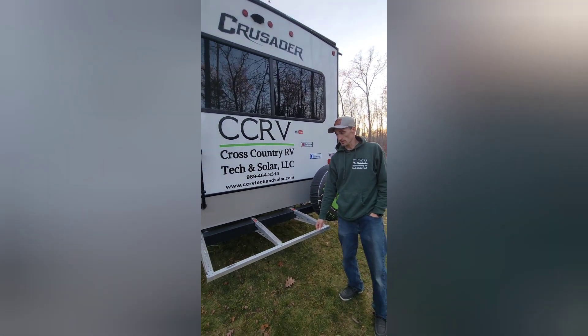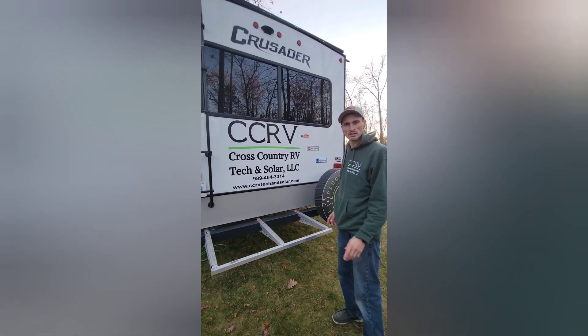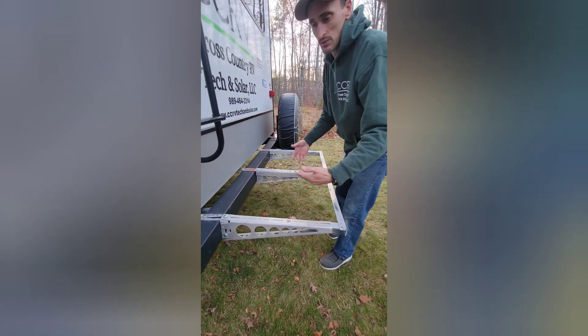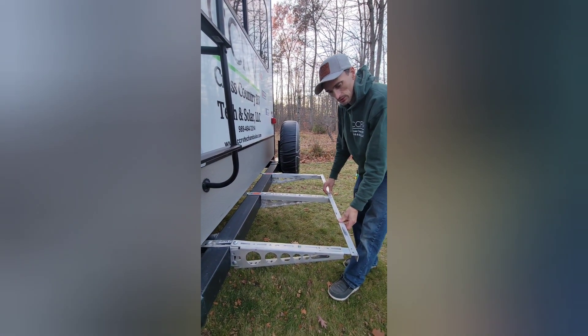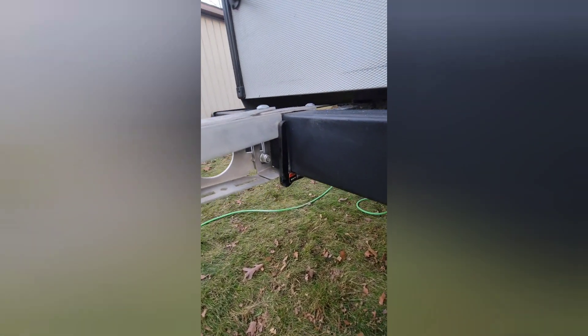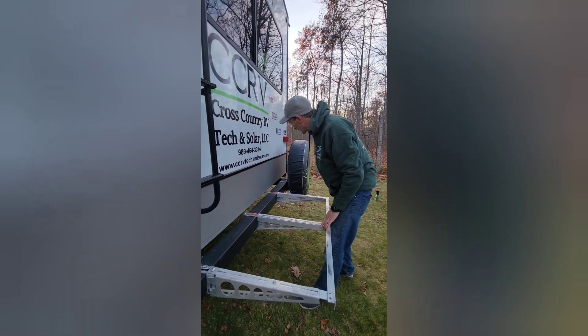Here at the back of the camper, I built a rack to carry our portable panels — they're stored away right now because we're plugged in at my parents' place and don't need them. This was originally a generator rack, intended to mount a generator. I reinforced it with some heavy angle iron and rivets, and I also reinforced the bumper — you can see this black piece here — so I didn't rip off the bumper putting that weight on there. If you ever mount something on your bumper, pick those reinforcements up; they're cheap and easy to install.